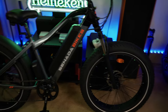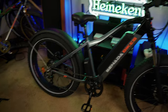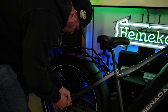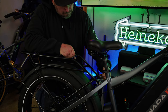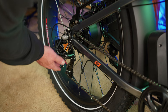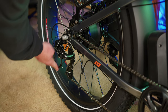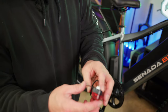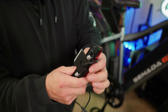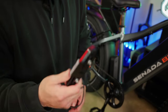We're about 95% of the way done. I have to say I like the way this bike looks without the rear rack, but we're going to put it on for demonstration purposes. Pro tip: derailleur guards end up getting bent during shipping and pushing against the derailleur, so if you see it touching, pull it back. Looks like the rear taillight bracket actually broke off during shipping, so we won't be installing the rear taillight — unfortunately it's a casualty of the damaged box.